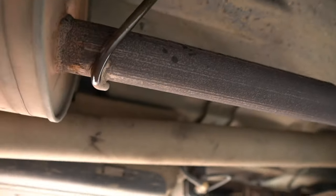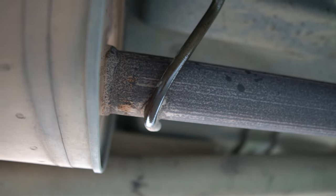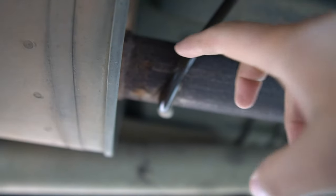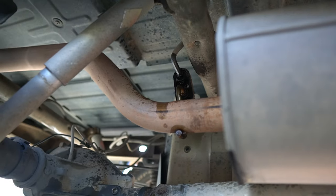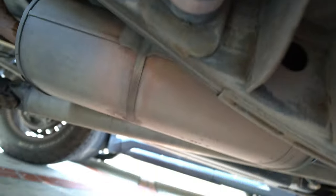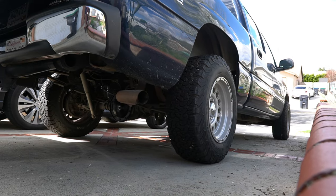So let's take a look at where I'm going to be cutting. I'll do a before and after, hopefully my neighbors don't think I'm trying to steal cats or anything like that. I'm gonna have it right here underneath the crew cab door. I'm gonna cut as close as to the muffler as I can, and I'm not gonna weld it — I'm gonna use exhaust clamps. I already sprayed it with PB Blaster, so we'll take this whole bad boy off. Let's get to it — let's hear a before and after.